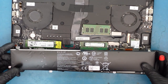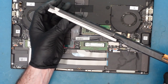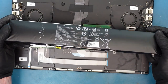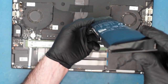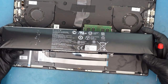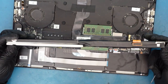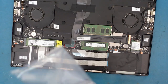There's actually one missing over there. If I turn this to the side, you can see what the problem is — see how thick and bulging it is? This isn't supposed to be white here. It's a very thick, bulging battery — it looks like a balloon almost. It's always a little bit harder to show depth on camera, but it's definitely ballooning up. We want to make sure we dispose of these properly. We're a tech shop with e-recycling, and you don't want to throw this in the trash.